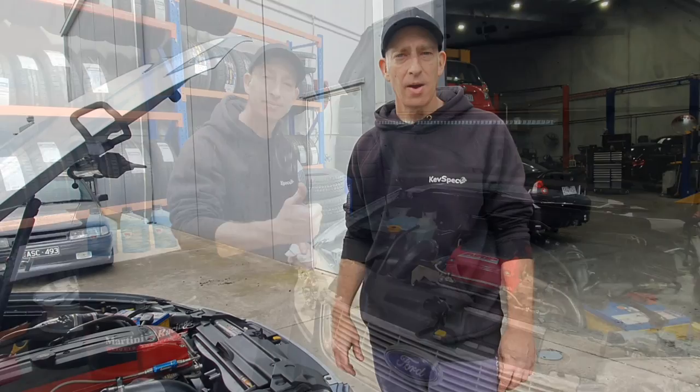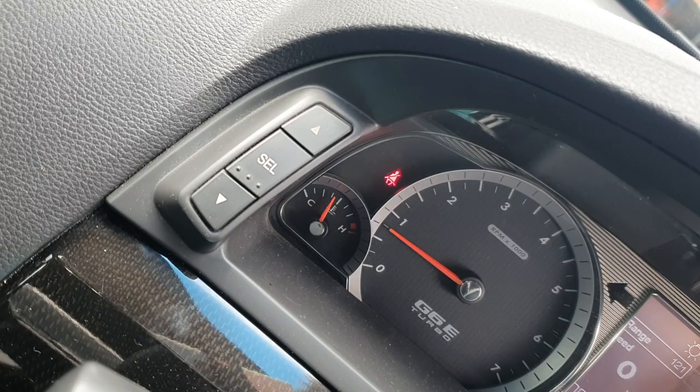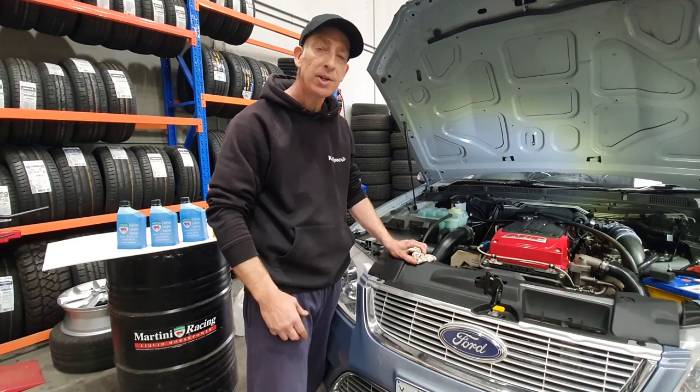So we've made sure our top radiator hose is hot, our bottom radiator hose is hot, and the heater hoses are hot — so we've definitely got circulation through the system. The temperature gauge is at operating temperature. Look at that — we're at operating temperature, right where the gauge usually sits. All right, so we're just going to switch the engine off and drain this flushing water out of the system. We've flushed the system twice with clean water, let it come up to temperature twice, and let it drain back out, so it's got a nice clean cooling system.